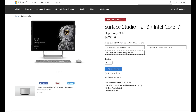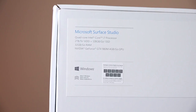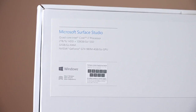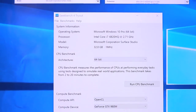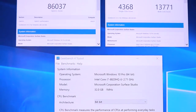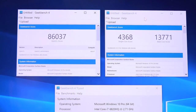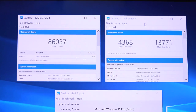In terms of specs, this is the top-end model. That gets a Core i7 quad-core, which is a sixth-generation processor with 32 gigs of DDR4 RAM. We also get NVIDIA's GeForce GTX 980M with 4 gigs of GDDR5 memory. We also get a 2TB hybrid drive, which combines the speed of an SSD with the inexpensive storage of a hard disk drive. These specs are not terribly impressive for such an expensive computer — the quad-core is clocked at around 2.7 GHz. We do get a lot of RAM, which is useful for most primary apps. In terms of Geekbench scores, it delivers around 4,400 on the single-core score and almost 14,000 on the multi-core score, with graphics coming in at around 86,000.